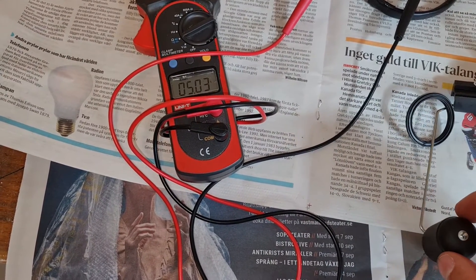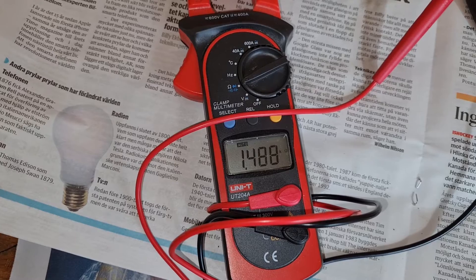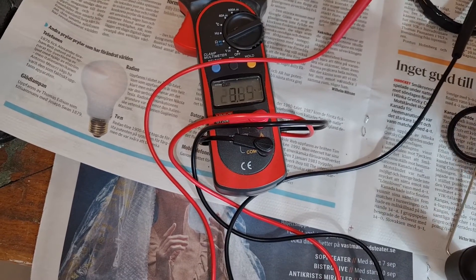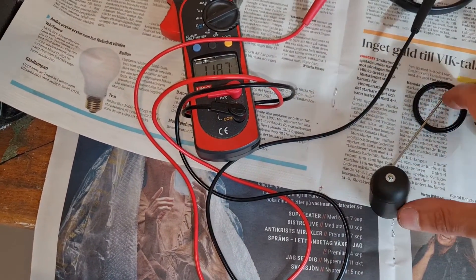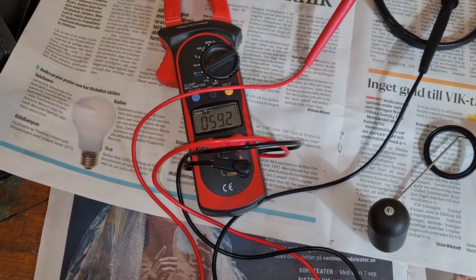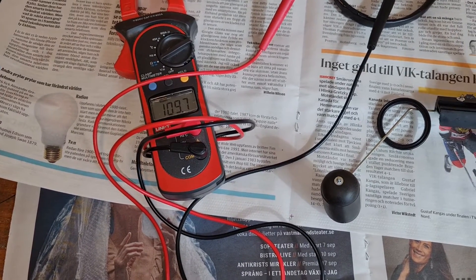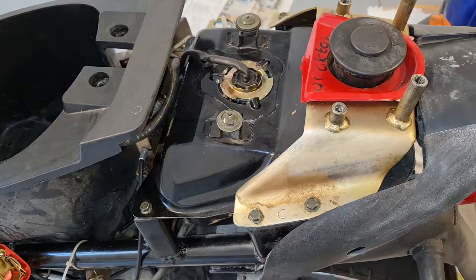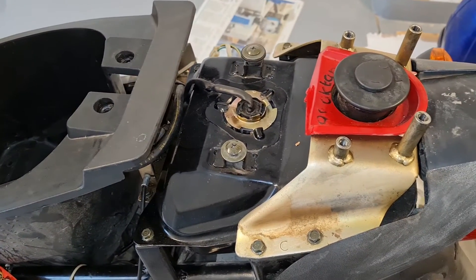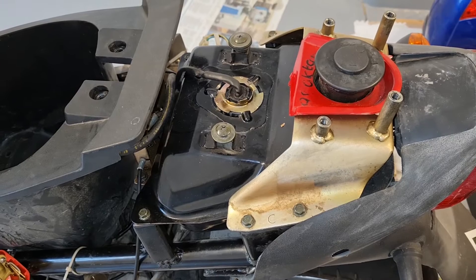At the empty position, there's a smaller resistance - like 1 kilo ohm. That's a way to test your fuel sender. The arm should move lightly and easily since it will float. Now we're up to over 100k. That's the reading. I'm going to replace this one now - it has lost its floating ball. The previous owner must have lost it. It doesn't work so I will replace it.